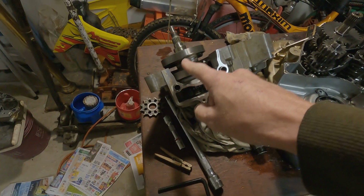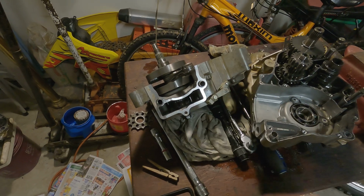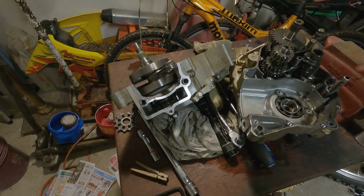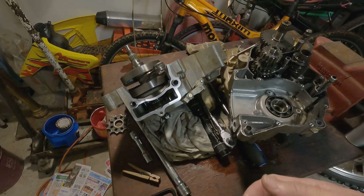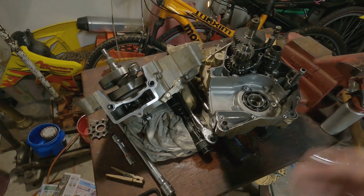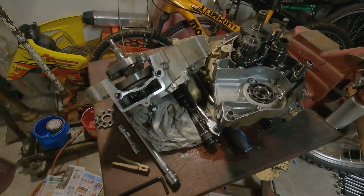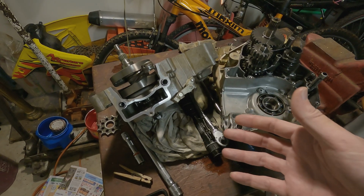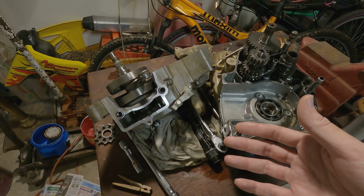And they had this hot rod one, and it's a 3 millimeter stroker. And I was like, I don't want to mess with all that. It messes with the stroke. It gives it a 3 millimeter boost in the stroke and brings it to a 264 cc, but then you have to get a different, shorter piston. I was like, I don't want to mess with all that. Then I found the Pro X, which they say is a better crank than that hot rod. People have a lot of problems with that hot rod crank.